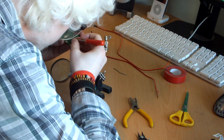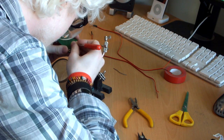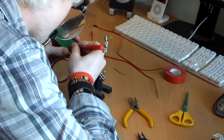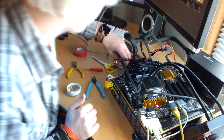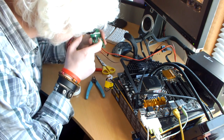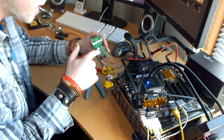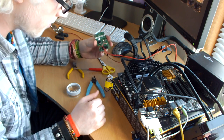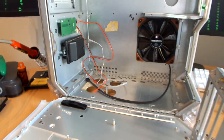I will be picking up another power LED and power button board and my dad's going to do it for me properly. I've got a feeling mine isn't going to last two minutes because I accidentally half ripped off the power button - it still works to a certain degree. One little thing to note: I picked up some power switches and motherboard headers on eBay with wire attaching positive and negative. These were really handy throughout the build. If you use the original ribbon cable it's very difficult to hide that big grey cable - you only need a positive and negative from the power button and a positive and negative from the LED, so four little wires are much easier to hide.